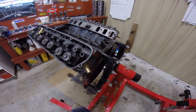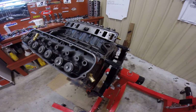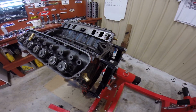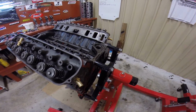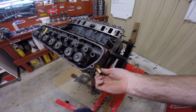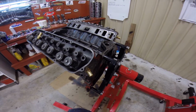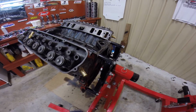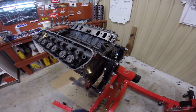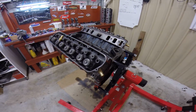They're cheap enough, and I'm going to actually suck the oil and draw it back into the sump by a pump, and it'll just be on while the engine's on, pulling oil flat out and returning it to the sump. And I think that's going to be a little secret to keeping the oil in the pan, and this is where they really suffer, these old style engines.